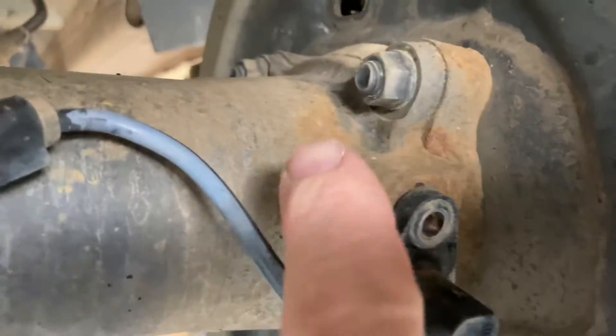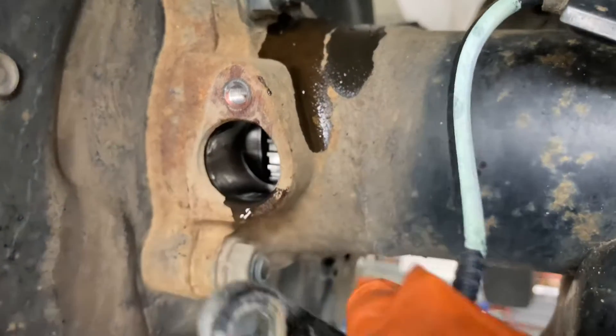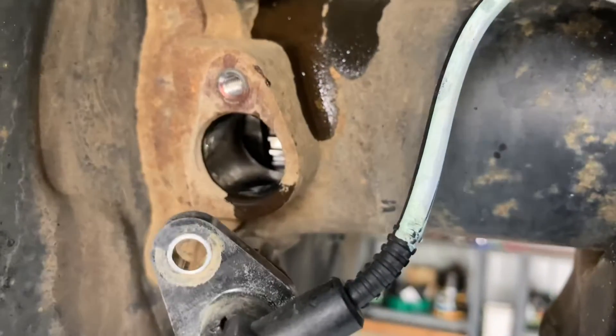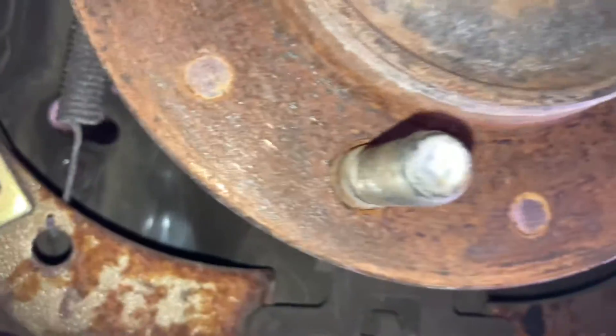We're going to undo these bolts and pop the axles back just enough. We're going to get this drive shaft unbolted. I'm going to mark it before we take it off so we put it back in the exact same position. There's a mark there already — yellow and yellow — so factory or it's been off before. Undo those four bolts, take note of which way they are and put them back the way they were. We also need to disconnect the handbrake cable from in here and pop it out the back of the backing plate so it's not in the way. And you're going to need to drain the diff oil out.